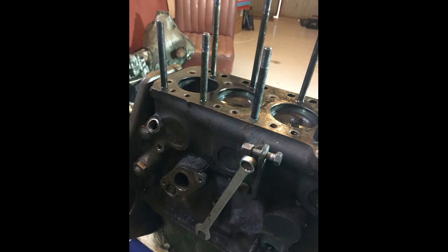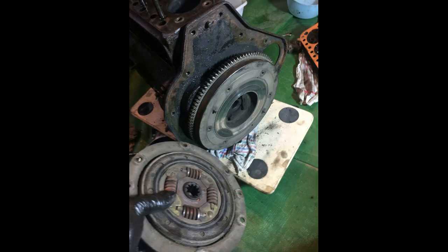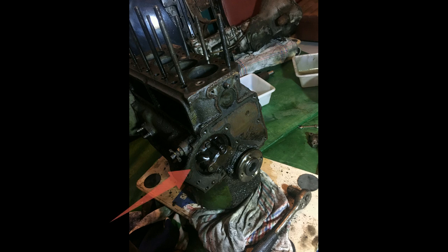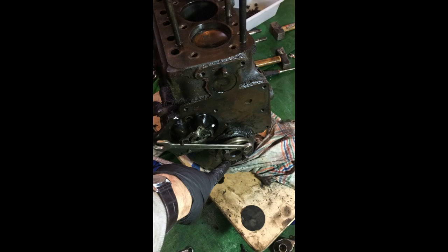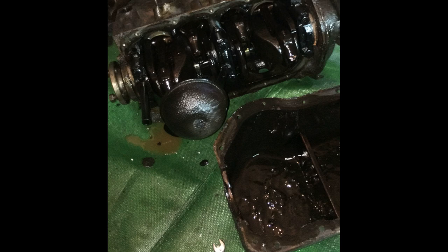Here I'm removing the dynamo support plate. The clutch is a piece of cake to remove, just a few bolts. Now the flywheel can come out — just make sure you put it back the same way to keep balance. Removing the back plate reveals the oil pump. Removing the crankshaft pulley was the hardest, it was really really tight. With a spanner I made sure the engine was not rotating. Now it was time to remove the oil sump, which reveals a layer of thick mud.